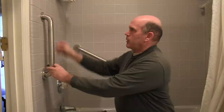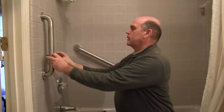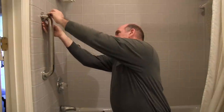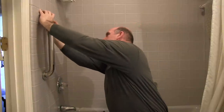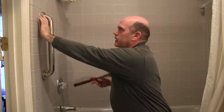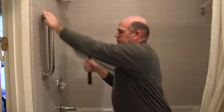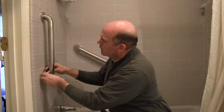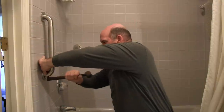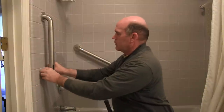Now these rings, they just snap on. You see these dimples that stick up here? There's one here. So you line the little bump up with the dimple. The dimple in the back here is the hardest one to get to, so I'm just going to line it up with that one and then snap it on — a non-marking hammer would work better, but this is what I have. That snapped on easily. You have to be careful to hit it just on the edge so you don't dent it.